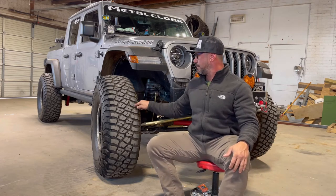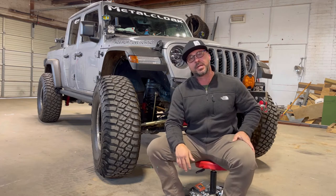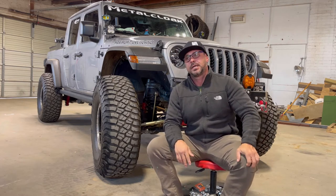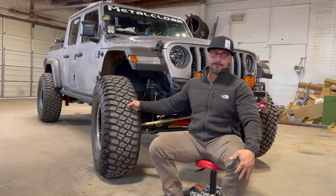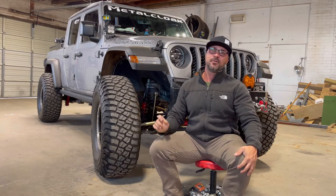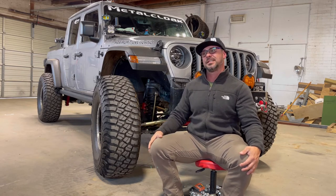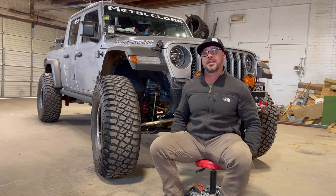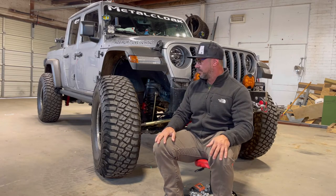No rock yet — that's next. But if you watch my video on the Ronde of the Ozarks, I navigated that entire park with this big rig in two-wheel drive with traction control off, just lowering pressure to about 16 pounds. He tracked through the big, thick, heavy mud with no problem. That says something.